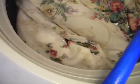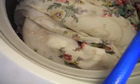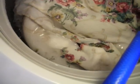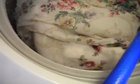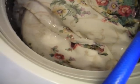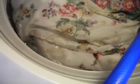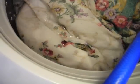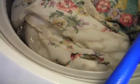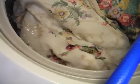Now, do you think that blanket on top's ever going to see any agitation down there? No. I don't think so. Nope. So how's that part of the blanket going to get washed? Probably not. Well, I'd say probably nothing. This is the agitator. This is on bulky item. This is the most water that this washing machine will put in for the fullest load you can put in it. The problem is, there's no agitator. When you put that much water in, your clothes do not get agitated. If your clothes do not get agitated, they do not get clean.